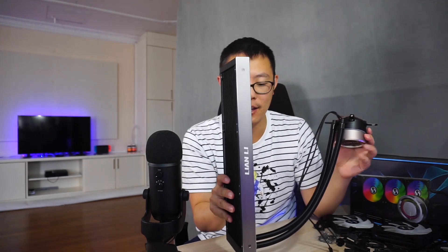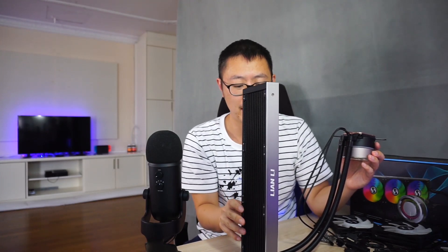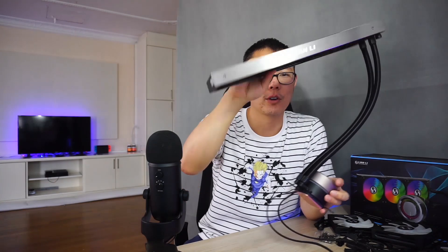But if you want the best case in theory for an AIO, I would probably have the tubing down if you can — though a lot of cases and radiators have tubing that's not long enough to do this. So that's about all I have to say about AIO orientation. To conclude: you want the pump submerged somewhere in your system — that's good, and this is good — but not where the pump is higher than the rest of your system. I hope you enjoyed the video, and if you have any comments or questions about this topic, make sure to comment down below and I'll try to get to all of your comments. I'll see you in the next video.